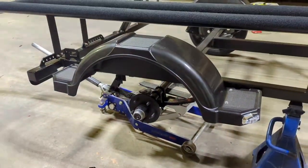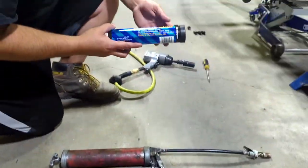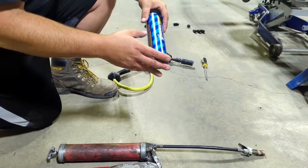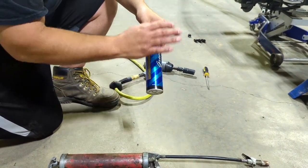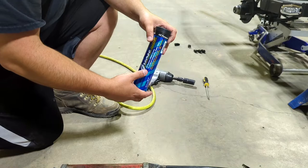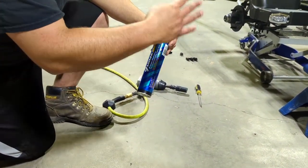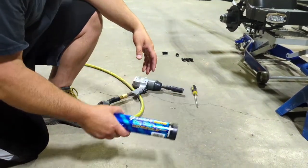For the next step, you'll need a grease gun and all-purpose lithium grease — this one is by Grease Master. We've already got a tube in here, but you'll want one ready. I'd maybe grab two cans if you're doing the full axle replacement of grease after 10,000 miles. The grease bolts only take about two pumps, but for the hubs you'll be filling grease all the way through until the old grease comes out, so grab a backup so you don't run out mid-project.